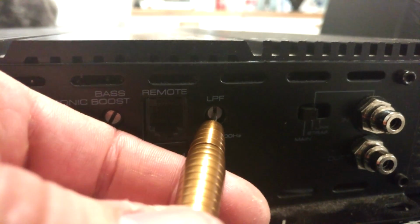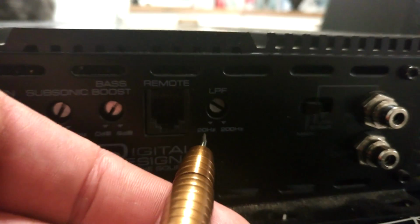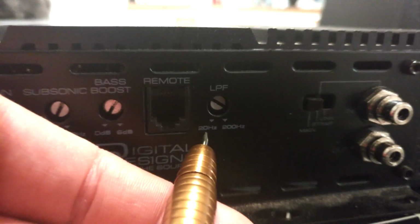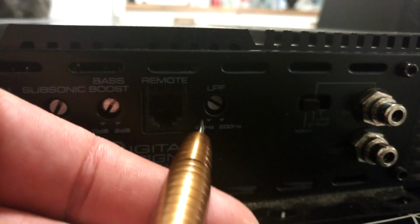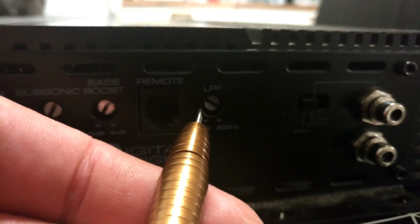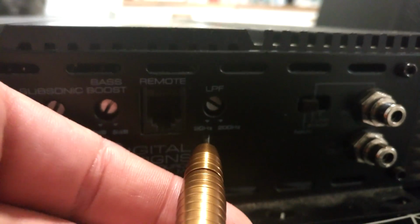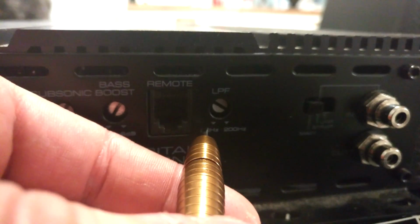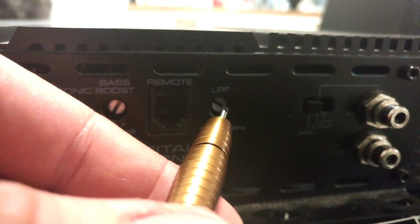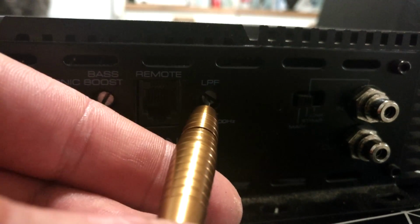Now if we put this between the 110 Hz and 20 Hz, it will go from 20 to 110, which is 90 Hz from here to here. And 90 Hz divided by 2 is 45 Hz, plus the base value of 20 Hz, which is 20 plus 45, which is 65 Hz. So this setting here is 65 Hz.